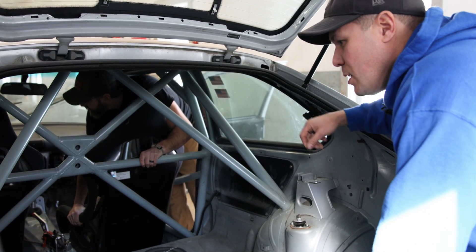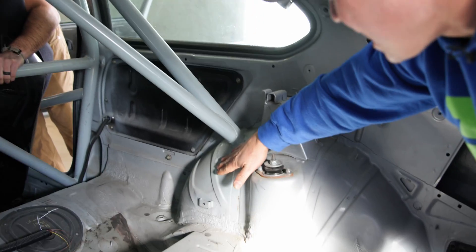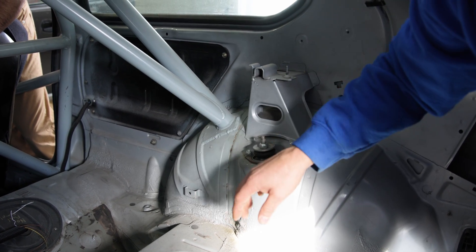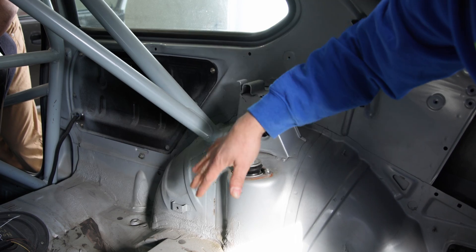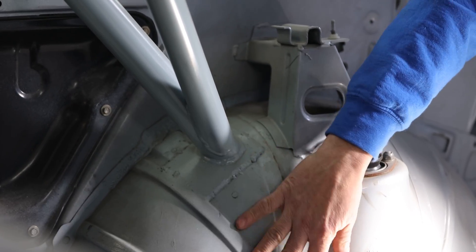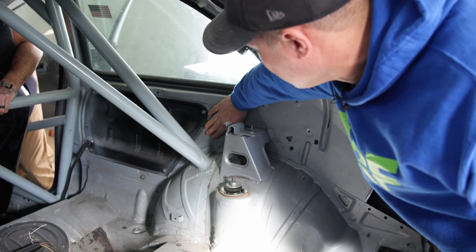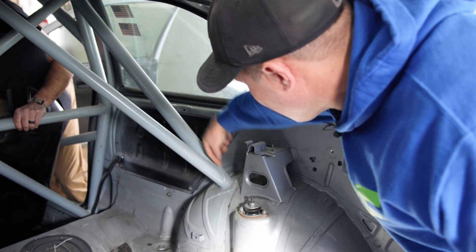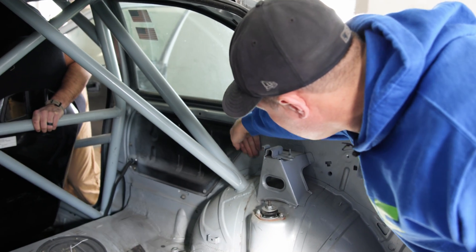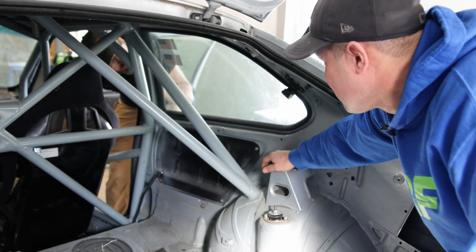One other thing I noticed — we were talking earlier about base plate design and being multi-plane. This is really a single-plane base plate. It's also not tied into the suspension; this is just going on with a thin piece of sheet metal. So it's vulnerable if it's hit from the side or if this is loaded this way — the only structural strength we really have here is this small thin piece of wheelhouse. Instead, even if you just had another piece of base plate that went up into this body panel here, having metal in shear rather than compression when it gets loaded — it's very easy to just push this down. Whereas if you had engagement in the side, you'd be trying to tear the entire panel; it would be much stronger. Again, this is perfectly acceptable, but it's definitely not ideal.